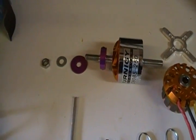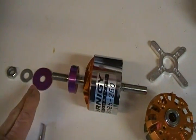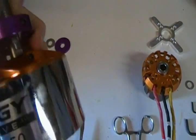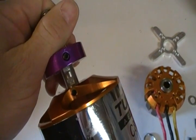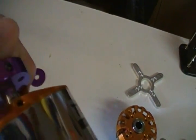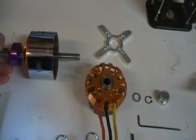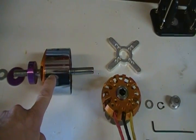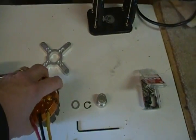When looking at the motor assembly sequence, here's your prop washer, prop nut, prop washer, pressure plate, and backing plate, which is normally screwed up against the motor. There are two set screws on either side of the motor and you can look on the shaft below and see that there are actually flattened areas for the set screws to go to. I've done some partial disassembly here — the bell housing here is pressed on and will slide off.